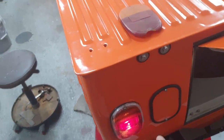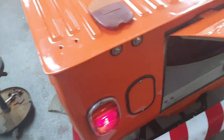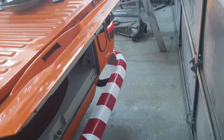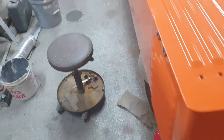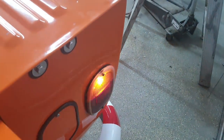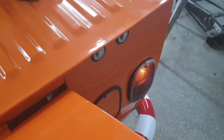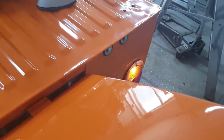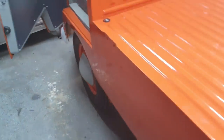I think this one wasn't working last time and that one was. Now I've got the turn signal lights up — yeah, that's why the turn signal didn't work when I used it last time. Weird. It's working right now. I guess when I was connecting up the wires, there's a wire issue down there. I gotta pull that tail out again so I can check it out. At least I got headlights, tail lights, and right turn signal.